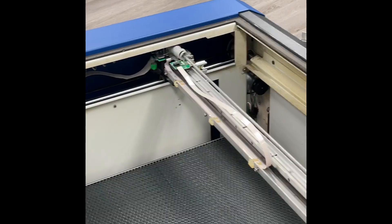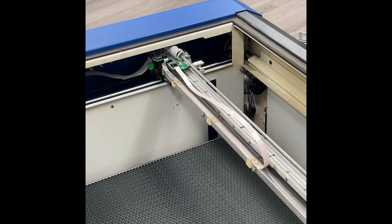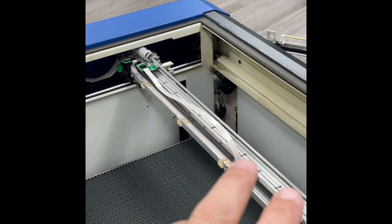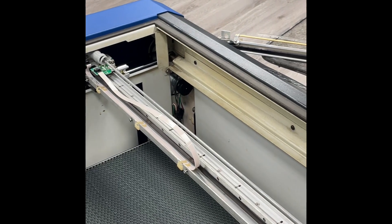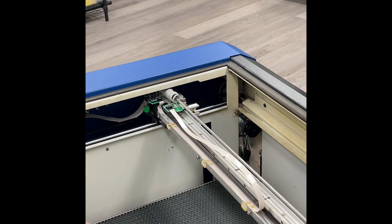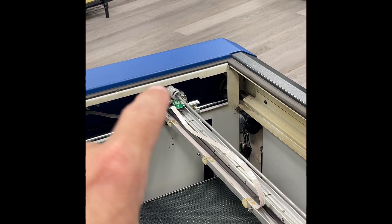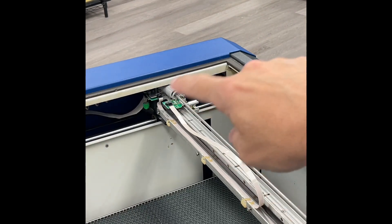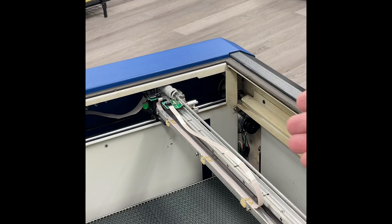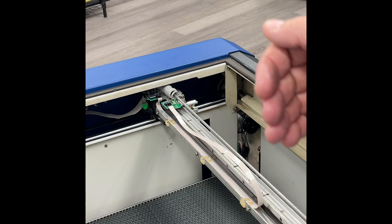As we discussed, if you get italicized or wavy text or logos in your engraving, the problem is most likely in one of these four parts in this x-axis motion system. Here are some general principles to look at if you're getting x-axis issues. This is the air assist tube — that coiled tube delivers air from the compressor to the lens assembly. If that is bunched up or stretched, it can cause an issue and possibly bind up the motion.